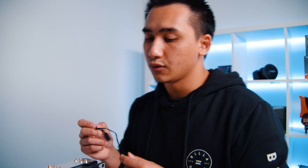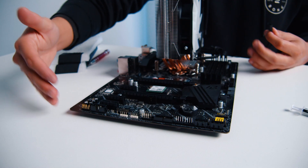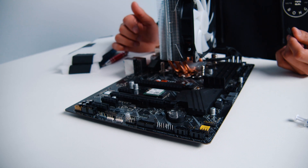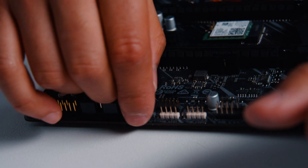If you do have an RGB fan like we do here, we have a little 3-pin RGB connector. You'd put your motherboard back into your case, or if you're already doing it inside your case, find the 3-pin connector already attached. If you're doing this at home, you'd either get an extension or route it behind your case to your motherboard. You want nice cable management — route it underneath through the grommets where you'd normally run your HD audio cable, USB 3.0, or regular USB connectors, then plug it into the 3-pin addressable RGB header. If you have a 4-pin, then you put it in the RGB LED header.